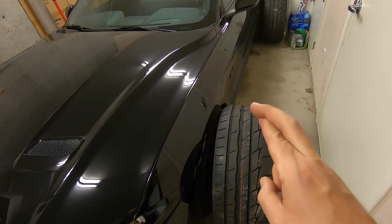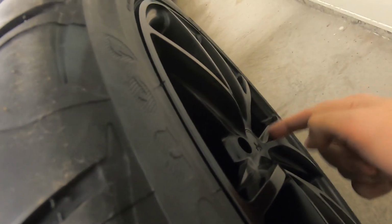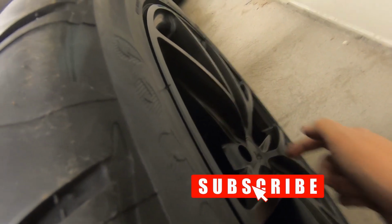So, like I said, fingers crossed. Hopefully they fit in. You can see when it sits like this how much taller it actually is. It's above the fender even. If you go straight across, you're just above the midpoint in this flat section of your fender. So they should fit, because if my math is right, these are almost a full inch higher than the other one, but that's measured straight up and down your wheel. So technically, once it's bolted to the hub, you should only end up with a half inch up top, and the other half would be below because it's measured from the center point.